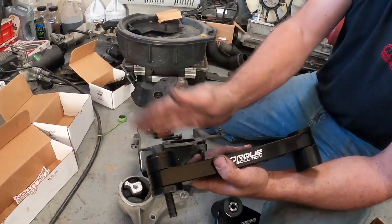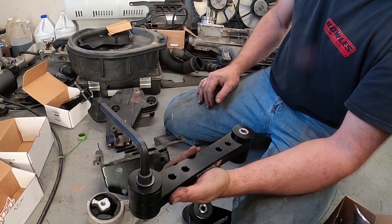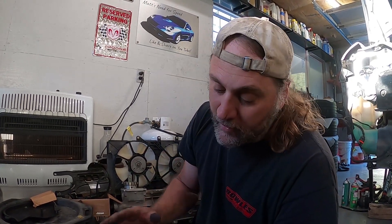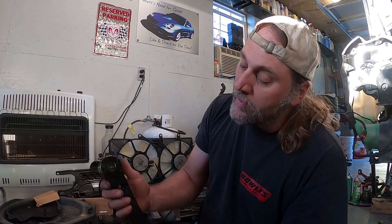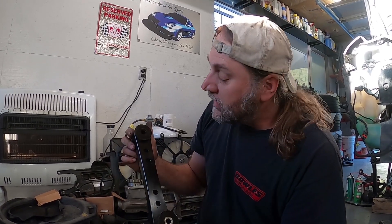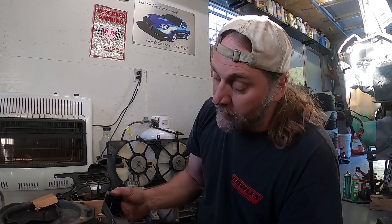The other bolt goes on the front side of this lower mount, and that's where this nice big allen head comes in handy. So with that said — when you install your motor mounts, whether it's Torque Solution, AGP, SDK, or any other manufacturer that makes mounts with bushings shaped like this, make sure you grind off your pins. It doesn't take long for a vibrating motor to dig into this material. It also helps you get it seated better. Do it right the first time.